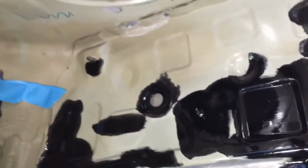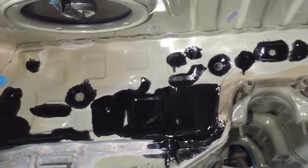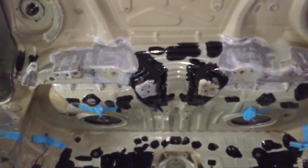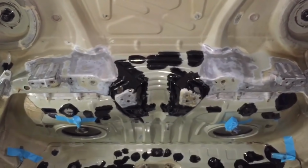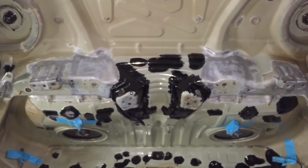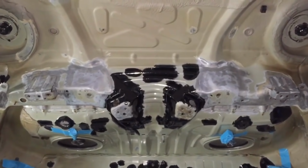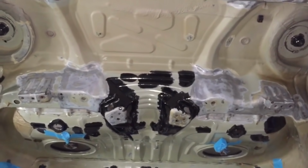So it looks very patchy now, but this is in progress. So that's the first stage we did about a day or so ago. I think at this stage we're probably about 18 hours in, we worked out, to do this properly. This is sort of restoration status, so this sort of thing doesn't get rushed or just glossed over. You know, the wire wheeling process, when we take seam sealer off and find corrosion and make sure we've got as much out of the metal grain as possible, that takes hours in itself, well over a day's worth of work all on its own.